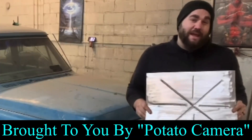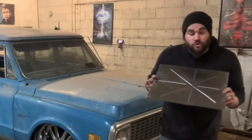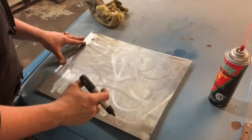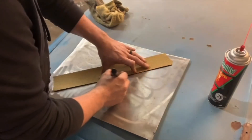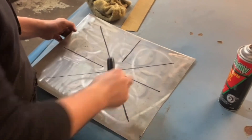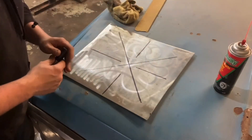The giant hole that I have in the floor of my 54 Ford is going to need to be patched. So let's make a floor pan real quick. The first thing we need to do is get our piece of metal clean, so we can lay out where we want our beads. We're going to take it over the bead roller, and that will give this piece a lot of strength. I'm probably just going to do the X, but I want to put some lines in there to help keep it lined up, and if it needs more strength I'll run a couple little beads there.